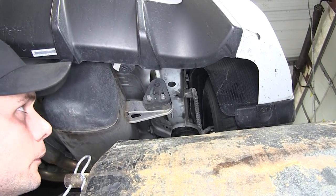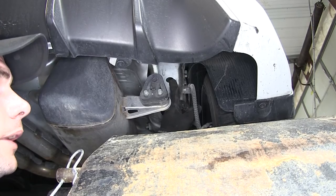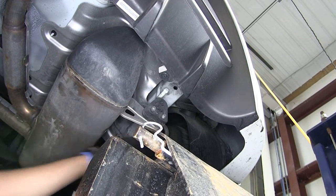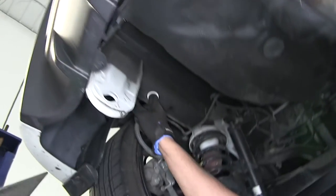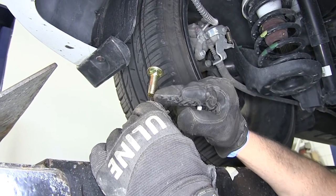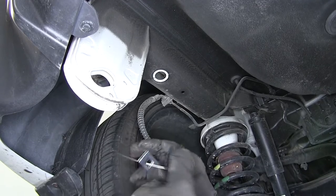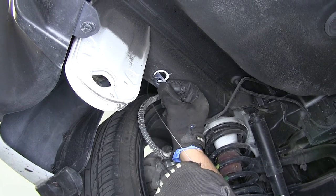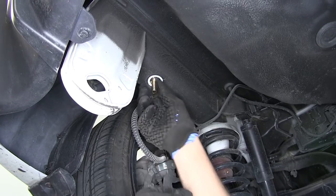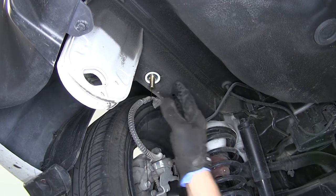With the hole enlarged, let's take a look at the three attachment points we'll use for the frame. One of our seven-sixteenths carriage bolts will come out of the larger hole. One will come out of the hole we just enlarged. We've threaded our fish wire onto the bolt and it goes right up through the hole. We'll also slide on one of the spacers, push it up inside, and pull the bolt down. Being a carriage bolt in that spacer prevents it from turning and allows us to get the hitch nice and secure.